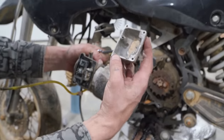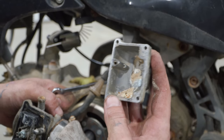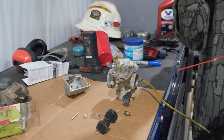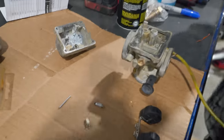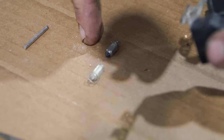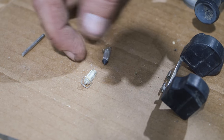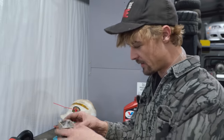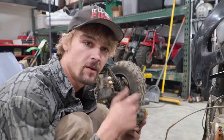We have spark! But the carburetor bowl — it's a sandbox in there, pretty bad. We had to go into our carburetor stash, because our needle and seat was rotted away — you see how the good one has the rubber cone that seats down and closes the fuel flow when the floats come up. We went and robbed one out of a GY6 200 carburetor or something, but it's going to work just fine. I got the carburetor as clean as it's gonna be on the inside — don't look at the outside — and let's see if we can get this thing back together.